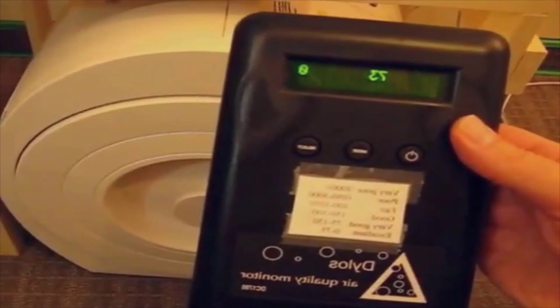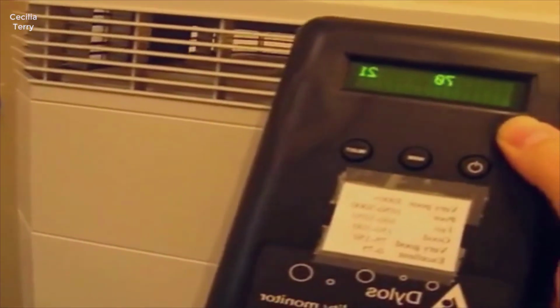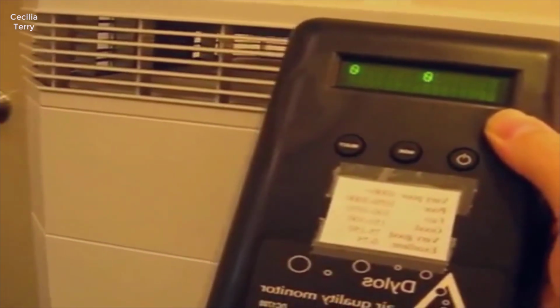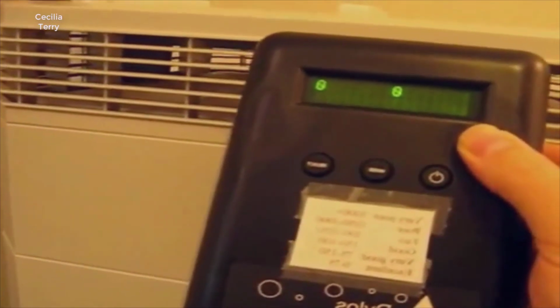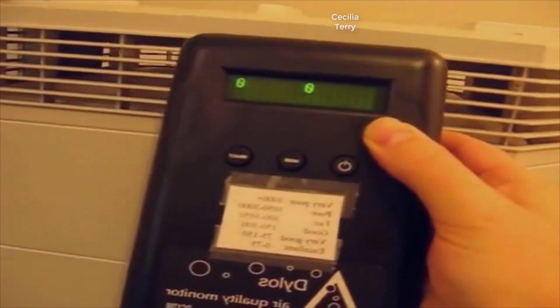Now, another thing that we don't like about the unit is its poor energy efficiency. Here it must be said that, remember, there are 3 very thick, very substantial filters involved here. So all of that air has to be pulled into the unit, has to be pushed past all 3 of those filters, and it takes energy to do that. So at the end of the road here, when you get up top here to the diffuser and you have 300 CFM of output, at that point, you need to pull quite a substantial amount of air through 3 very thick filters.